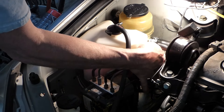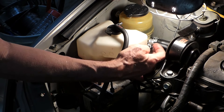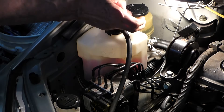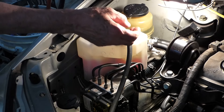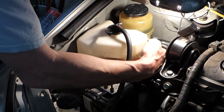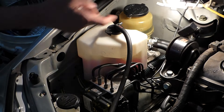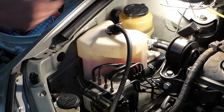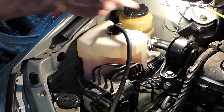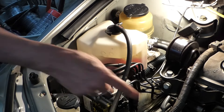If I run my finger under here, you can probably see that it's wet. So the leak is either coming from this hose being cracked under here, or possibly that the reservoir has a crack down here, but I highly doubt that. I don't feel anything down here — it's just at the connection here. So I'm going to pull this hose off, run over to the auto parts store, and see if I can pick something up in a similar size, because I haven't found just this hose — they want you to buy the whole line.